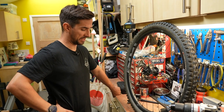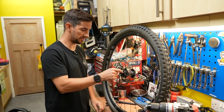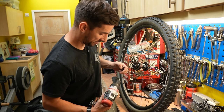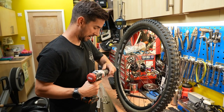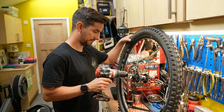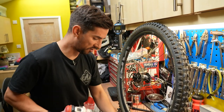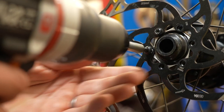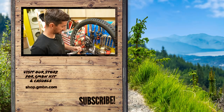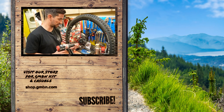This is one of my favorite maintenance tips because removing disc bolts is just a pain. I hate it — it's a horrible job. What I do is use my drill. You need to stick it on the screw setting so you haven't got it on crazy torque, and then set the clutch ring accordingly. There you go — makes a horrible job really fast. When I'm putting the rotor back on, I'll turn the tension right to the very minimum, get all the screws in, and then do the final torque by hand.